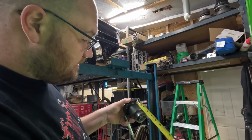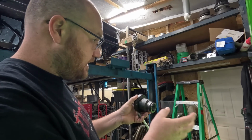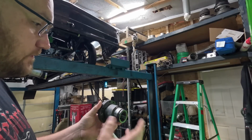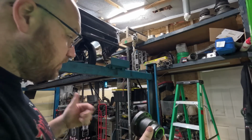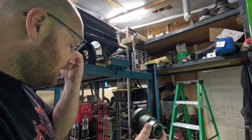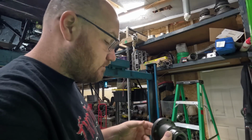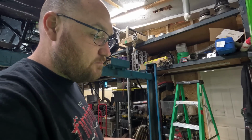So 1 3/4 of an inch, actually. The bolt just has the shaft, or has its own shoulder, and there's no support for the bolt. So, from what I can tell, I haven't pulled the balancer off, obviously. I do not believe the crankshaft snout's bent. It might be bent. It's a Dart center counterweight billet crankshaft, and I've seen a rash of broken ones anyways.